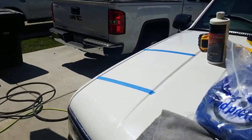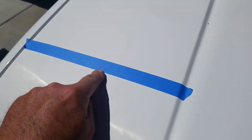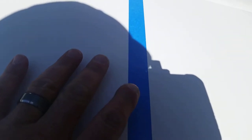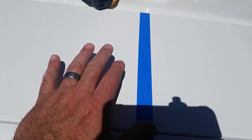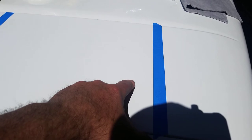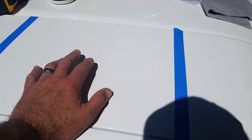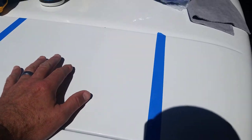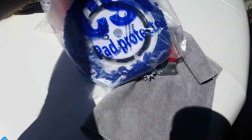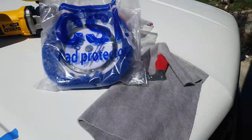I'm not real good on a rotary, so I may make an ass out of myself. Right here are 1000-grit sanding marks and over here are 2000-grit. On this side I'm going to use a DA and a different pad to show you. The 1000-grit removal — I don't have any 600-grit, but I'd do the almighty 600-grit removal with one polish. This is a generic white paint I had painted last year. If you buy from CSI, they'll even send you a pad protector — pretty awesome of Tom and Darren at CSI.